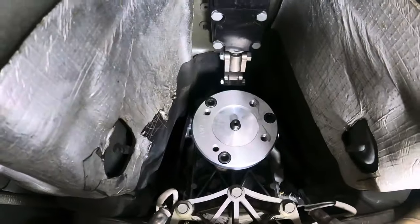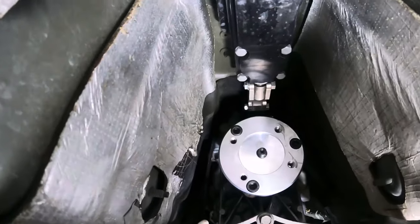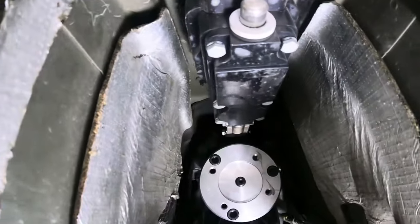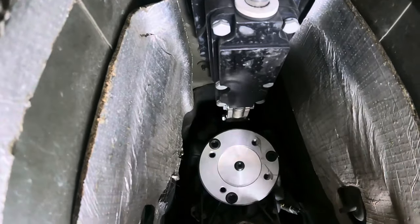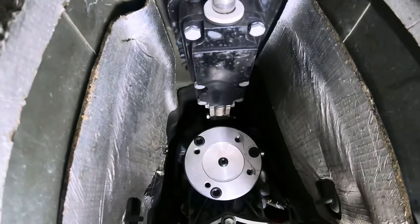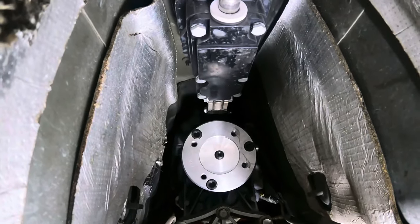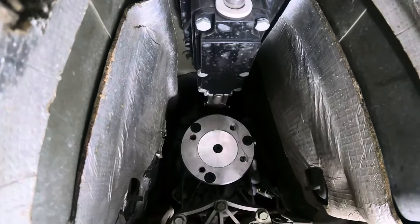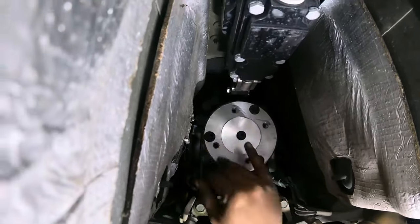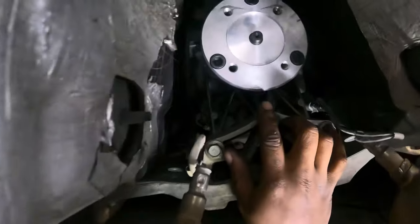So this is your Barton shifter, which is on the body mount. So if y'all wanted to run a drive shaft loop and y'all were running it on the trans mount, well, this would come off right here, back down to this. You have to remove all that and attach it right here and then reinstall this. Seen in the video, a little pain in the butt, but there it is. But I'm gonna put that facing down.